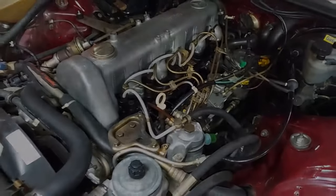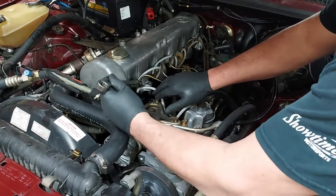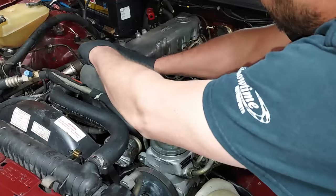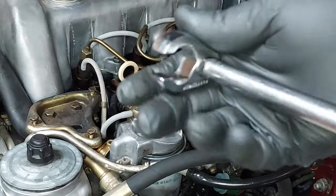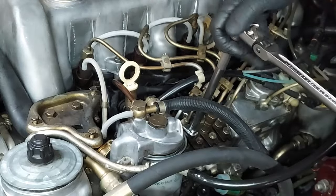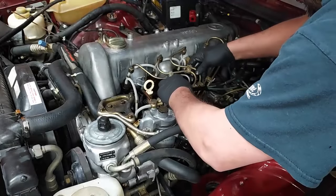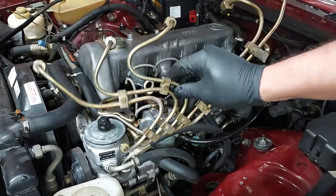Let's start disassembling all the parts. It's just a 17 millimeter — we need to go around and loosen all of the injector line nuts; sometimes those can be on there pretty good. Down here on the injection pump we use the same fittings. The best way to get those off is a crow's foot — I can stick it down at a 90-degree angle and get around there. They're actually pretty nice for being original, but just wait until you see them refurbished.